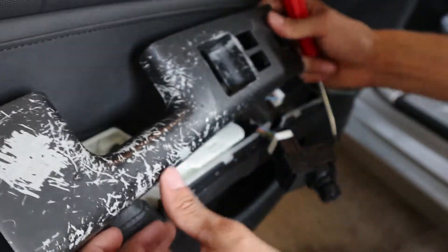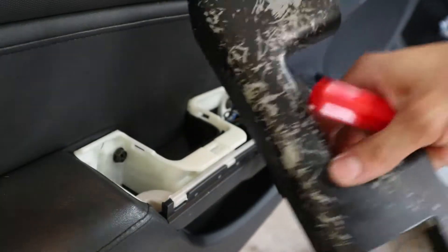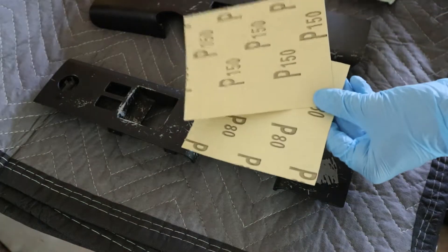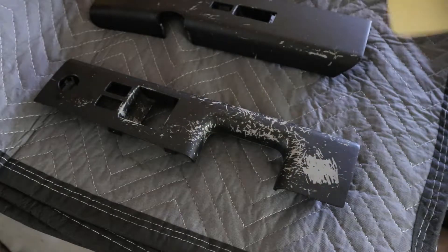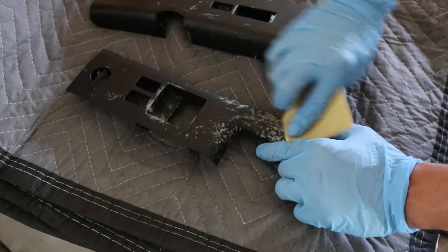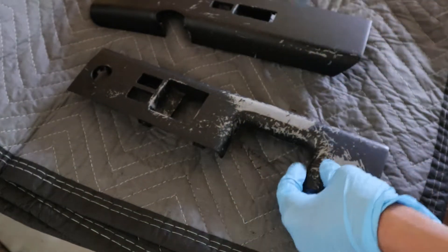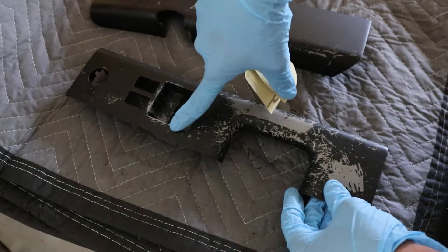Would you take a really good look at this one? How beat up it is? Look at that. I'm going to do some sanding. I got some 80 grit and worked my way to some 150. After that, 400, then 800, and then 1500 right after. I'll show a little bit of sanding on camera, but not a lot. Go ahead and try to start sanding this stuff off. The places I'm going to get the most are probably the places that are touched the most — right here around the edges as well.